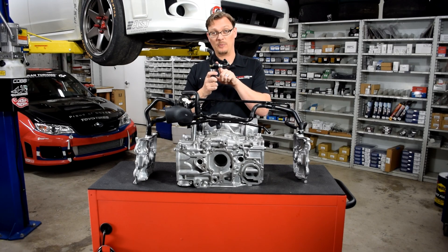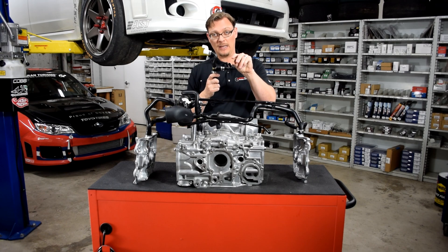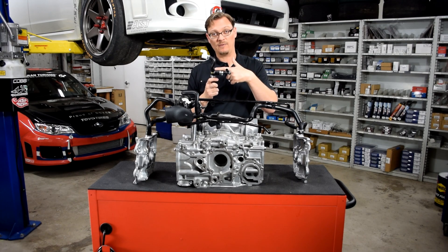In this PCV tree, this little bump here — that is your PCV valve. In the '02 and early '03 WRX, the PCV valve is actually threaded directly into the manifold. But either way it functions the same: when you're making positive pressure in the manifold, the pressure comes down this hose and shuts the PCV valve, so then it's not doing anything.